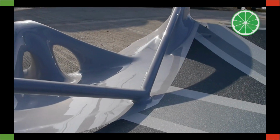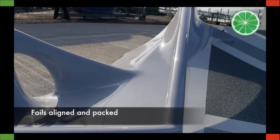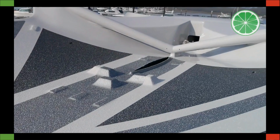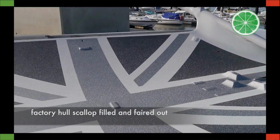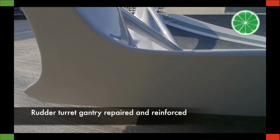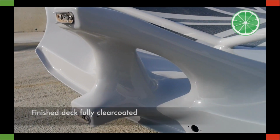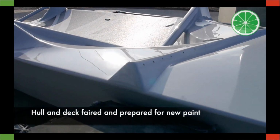If you leave it too long and you flat it back, you then start getting halos where you rub through the layers because it's gone off too much. I don't know why, but it seems to have a layer between the two sprayed layers, and that's the only thing. If you're spraying it thin, you've just got to keep going around your job every 10 minutes, because otherwise you will find these halos appearing as you flat through the layers. That's the only thing.